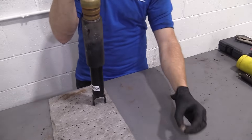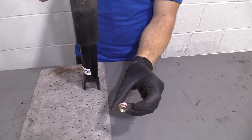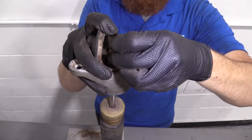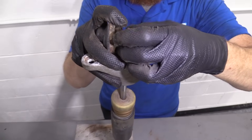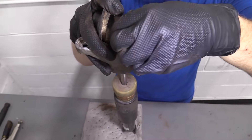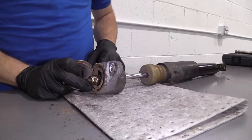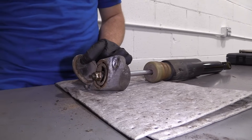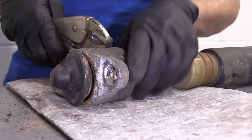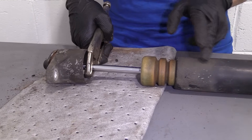We'll flip this up. Underneath there was a little lifter washer, nice and thick — that goes right there. We've got our brand new nut; it's a little locking nut, you can see it's got little wedges on there. Just going to put it right up in here. It starts on — pretty much bottomed out there. I'm still going to bring it all the way down, but that's as far as the lock's going to let me go. There are several ways you could do this. You can grab onto the top with some locking pliers and use a wrench. Or grab all the way up as close to the top as you can — you don't want to grab anywhere down close to where the piston rides up and down, because if you create a burr with this, you don't want to hit that seal.